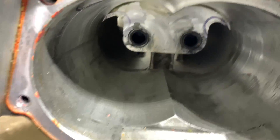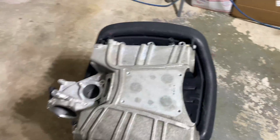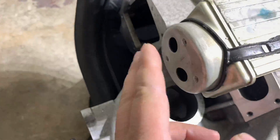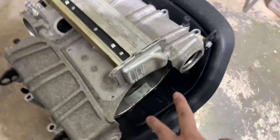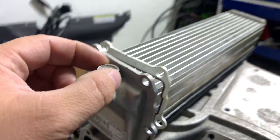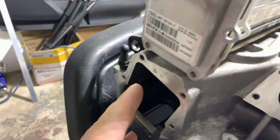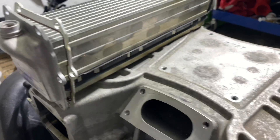It's going to be a lot of work and modification. I also came up with an intercooler idea — a friend in Russia is doing this on one car right now. We're going to use the original front plastic with two tubes coming in to supply water to both the bottom and the top. I'm going to remove it nicely, put a fitting in here so this is a one-way pass-through, and the exit of the water will be in the back of the supercharger — should add at least 20 to 30 percent cooling efficiency.